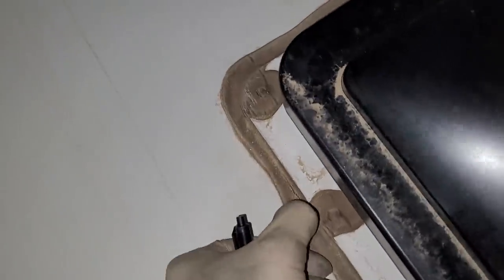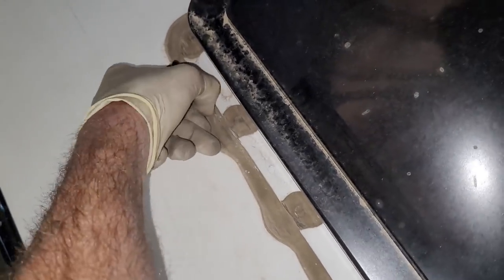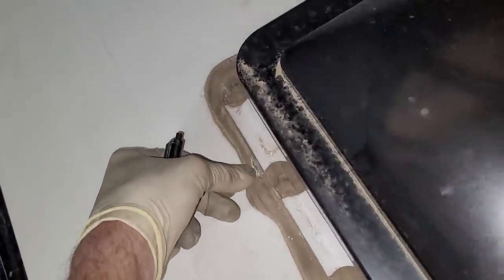You have a Fantastic Vent with a little bit of cracking — I guess probably just voids when they sealed it at the factory. It was just a tiny little seal actually holding it, and there was an air bubble below it, that's why it cracked. So just a little touch-up reseal needed.